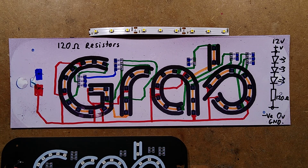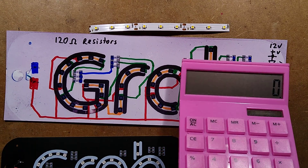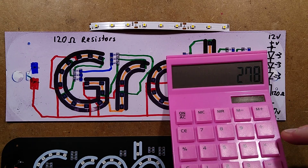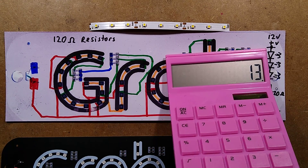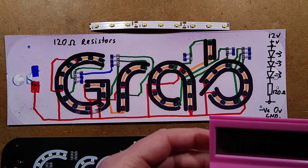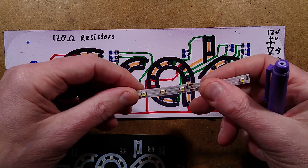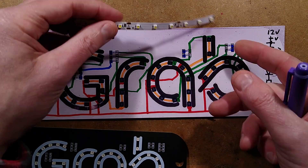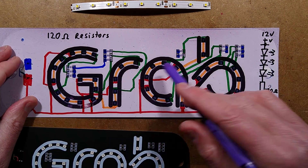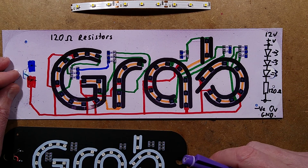If you work that out: 278 milliamps divided by the 13 circuits equals 21 milliamps. So they've basically optimized it for the maximum desirable current. On the LED tape they typically use 150 ohm resistors, but in this instance they're pushing it just a little bit hard — I guess because while the vehicles are active, the voltage of the battery is going to be pretty much at 14 volts.